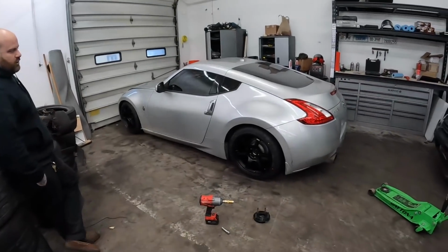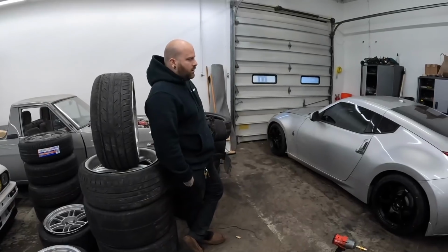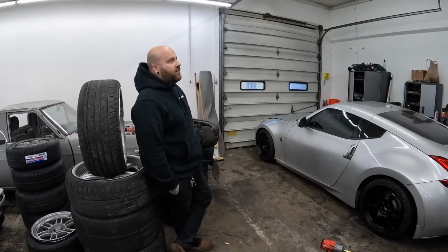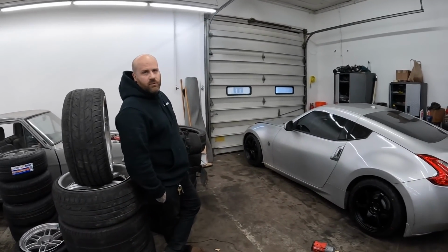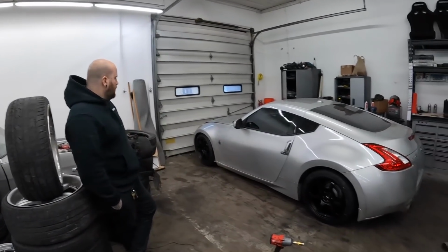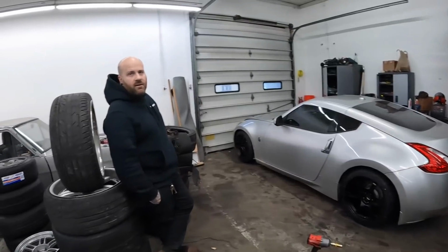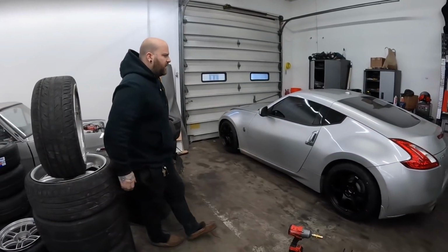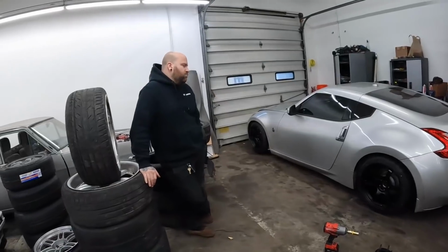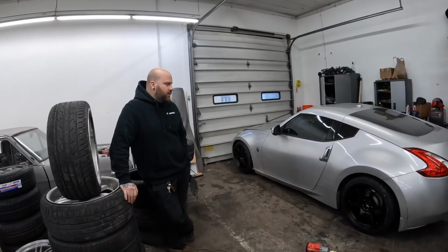Yeah, I mean, you can't do anything about it. It's crazy because you can't go up, because if you go to a 19, you can't get tires. I think a 265/40 would be the move. Yeah, maybe the 35 is just too thin. I mean, it's fine. And also, we're like 3 feet away. It looks a lot better with that 25 mil spacer. But also, black wheels are tough because they make it look a lot smaller. Yeah, I could see that.